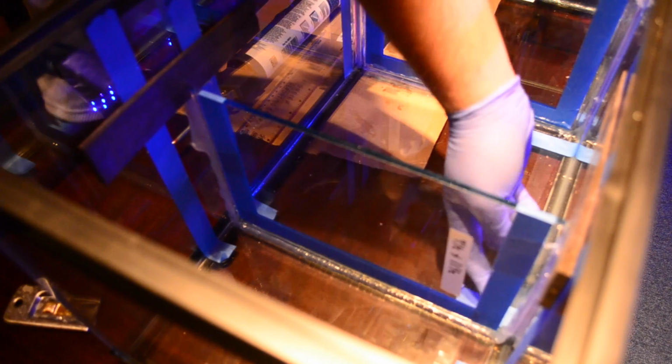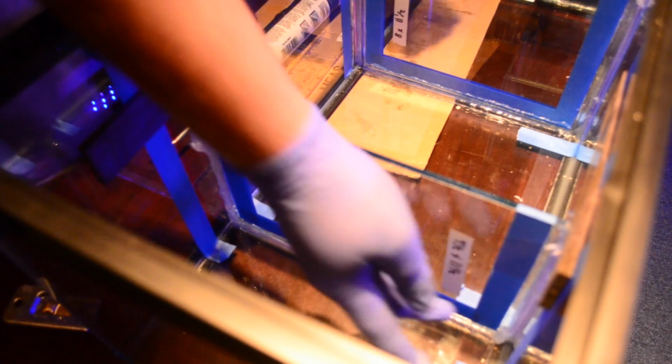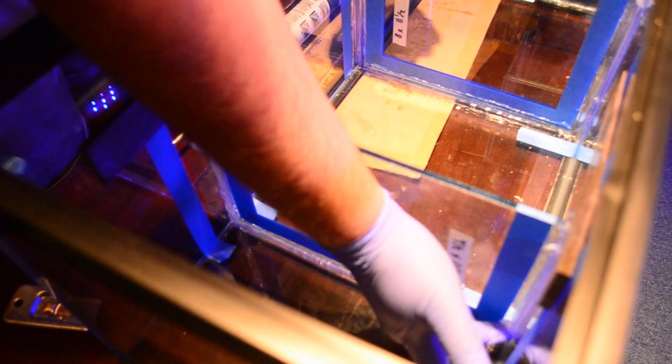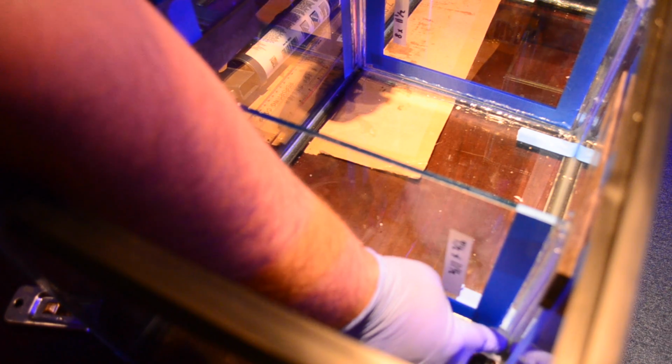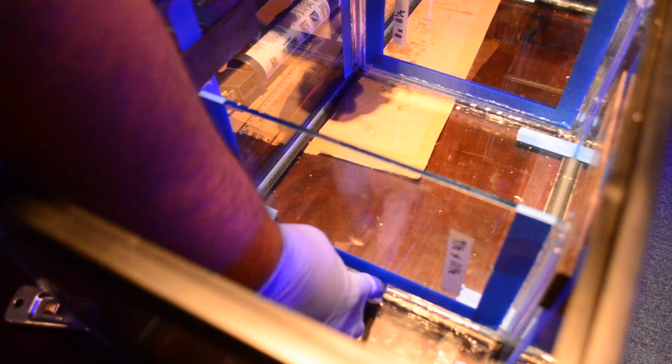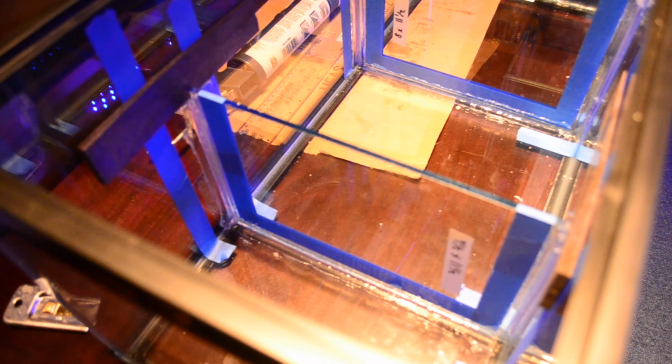Move that unwanted silicone, push any of it into those crevices to fill that gap. Now usually what I say, allow for at least an hour and a half to let your silicone dry. However, according to the bottle, it does say it will dry in approximately 30 minutes. But my rule of thumb is, the more you add, the more you dry. And me preferably, I much rather wait a lot longer for it to dry. That way I know my silicone is completely solidified and my baffle's not going to move.